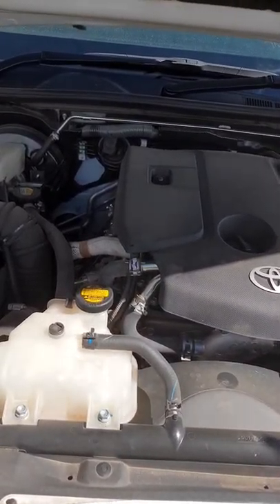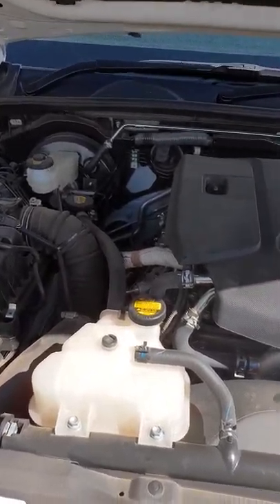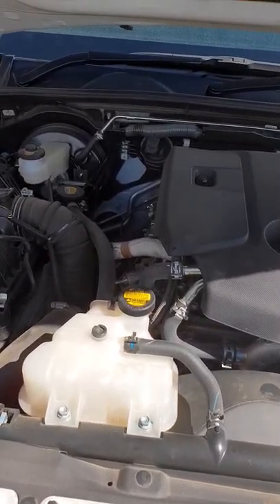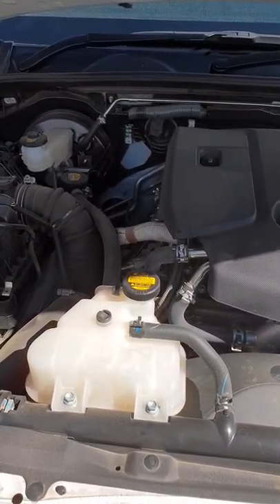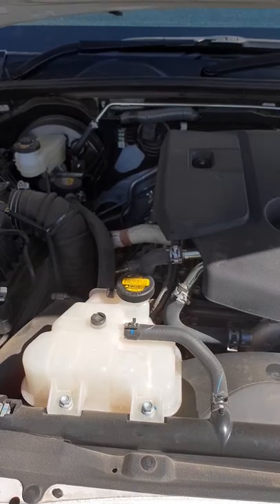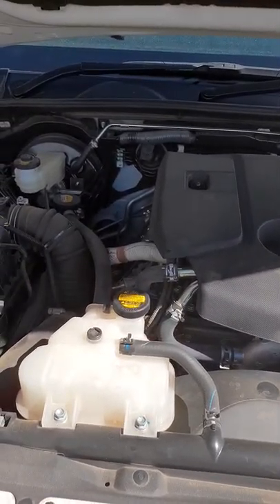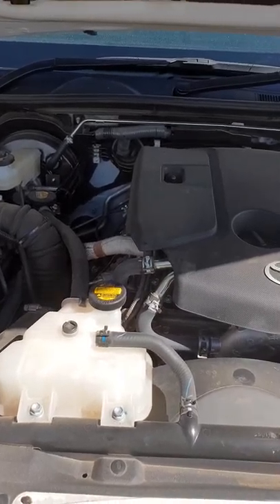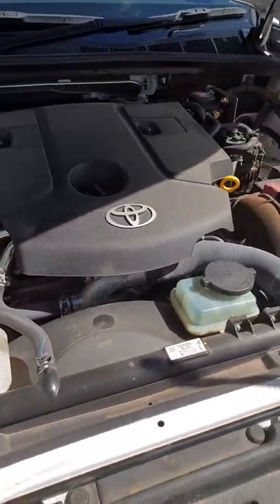This thing goes good enough for me. I'm not expecting it to be a 200 Series — it's a little four-cylinder diesel and it tows my van well. It does have a DPF delete and a straight-through 3-inch exhaust, just because I like the note, and also the DPFs have had quite a few issues with these models having to go back to dealers because they don't have a manual burn button and just crapping out at about 30,000km. I didn't want that reliability issue hanging over my head if you're out doing a desert trip.